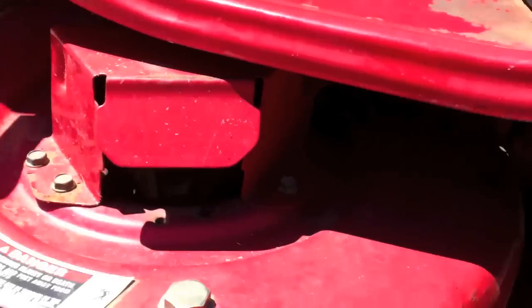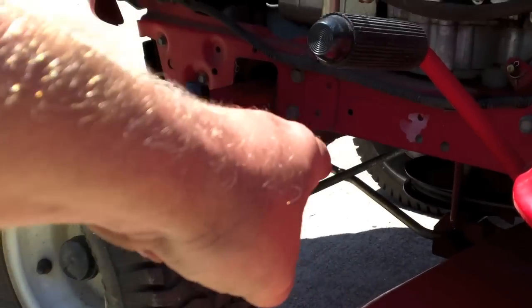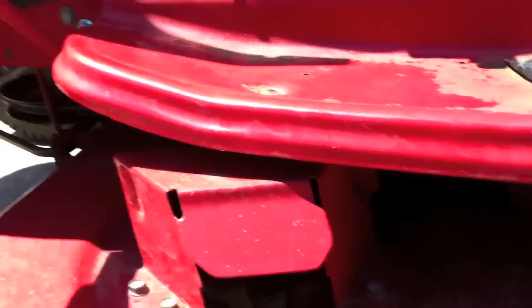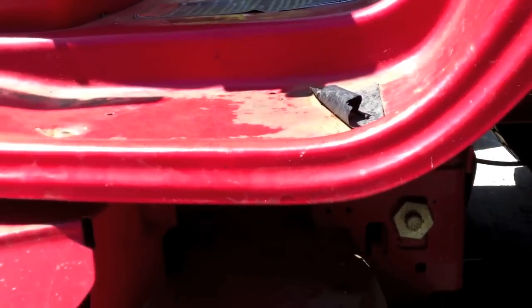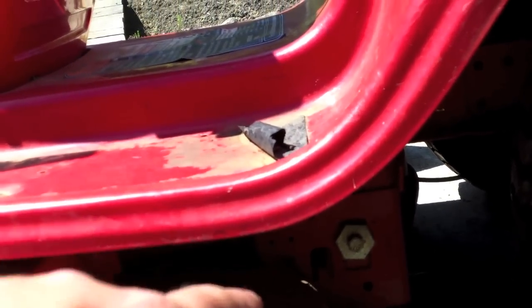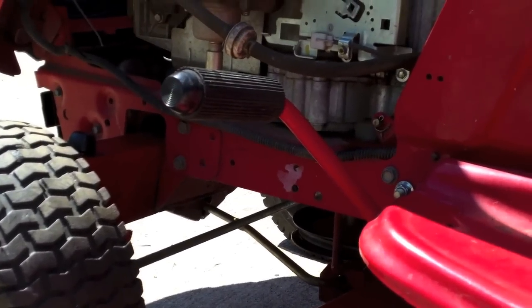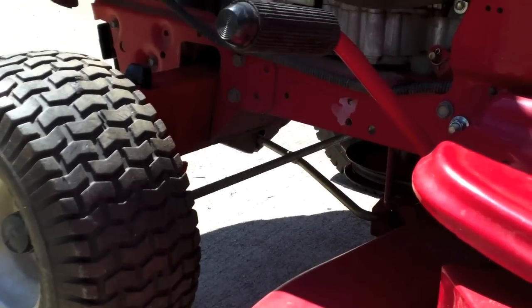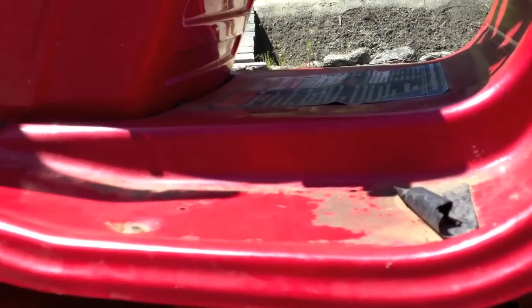I think I lost half the video, so I'm going to show you what I did — I'll try to clear everything up when I edit. I put the deck back in place. There are two hanger bearings, one on each side in the back, and a hanger in the front. There's also the belt you have to hook back up and the cable that actuates the cutting deck. I start at the back, set these guys in place, lock them in, put the clips in, then move up to the front, get the belt on, work it into place, then put the spring in place and the cable — making sure to put it under the cutting belt.